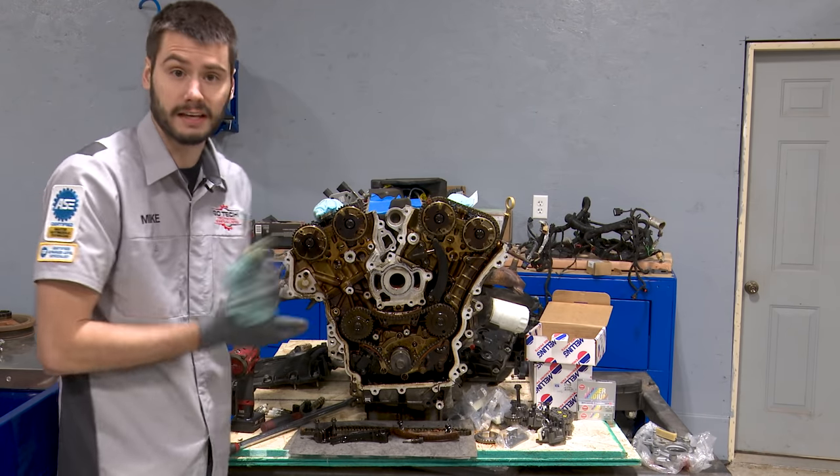Now I like to double-check everything to make sure our links and marks are all lined up, because as soon as we spin the engine over they won't line up again — this is a one-and-done thing. Check all your marks and compare to the timing diagram showing what stage two should look like. We're lined up on L and L on the left side camshafts with the pink link, yellow link visible through the sight window on the idler. On the primary chain we're lined up on all three marks. On the right side secondary chain we're on the circle with the yellow mark, and both R triangles with pink links. Everything appears in time. We'll spin it over a few times to check for any interference.